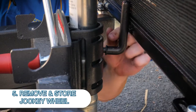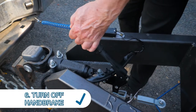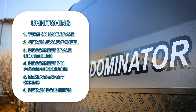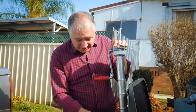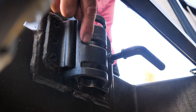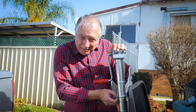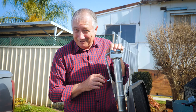Once you're happy and everything's good, you've taken away your jockey wheel. You can take your handbrake off and everything's right to go. To undo it, just do everything in reverse. Now here's a good little safety tip — these safety ribs on the jockey wheel are intentional because they're held on by the grips built into the jockey wheel holder. When you put your jockey wheel back into that holder, make sure the rib goes into the gap — that's important and you'll have a much safer trip.